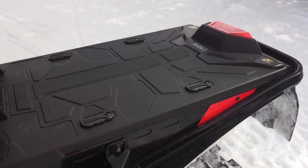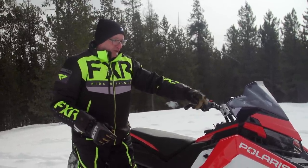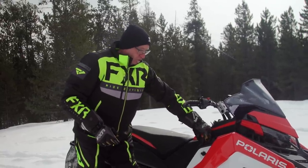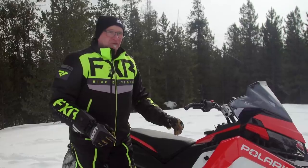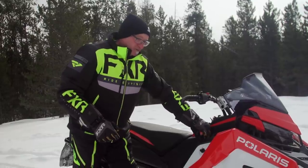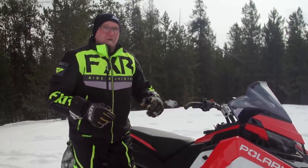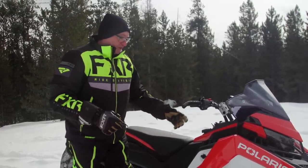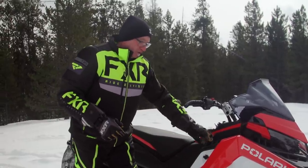There are some styling cues on the S4-powered Matrix models — the extra venting on the hood below the windshield kind of gives it away. There's also a new reverse shifter, and I want to talk about that for a second. Mechanical reverse shifters are often clunky, and electric ones can be vague. This one is a really nice working piece. I've been using it all day and it is slick — it never misses a shift, and when the belt picks up the secondary it doesn't clunk. It's seamless, almost like an electric shifter, but it's a mechanical deal going down to the chain case.